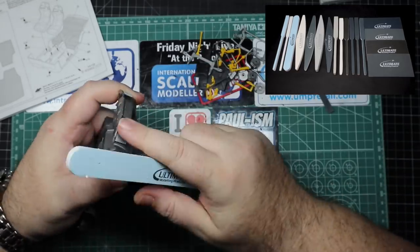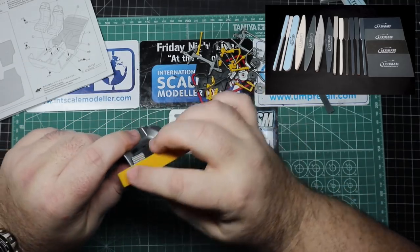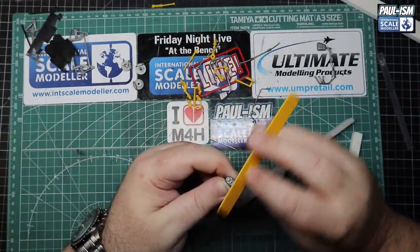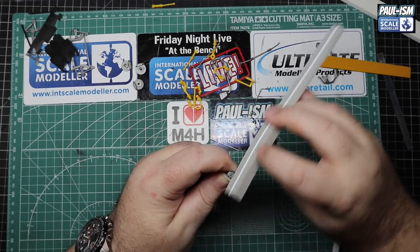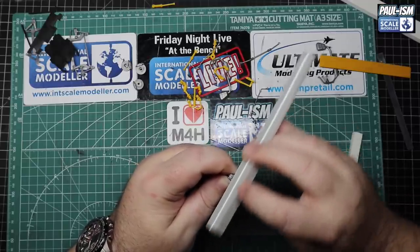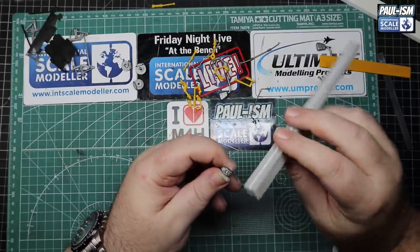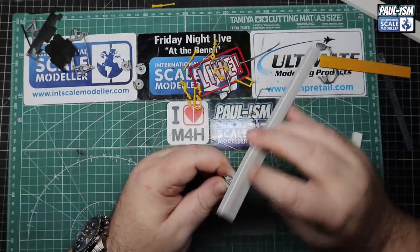Nice straight edge on the chassis. Easily cleaned up, so go around systematically, make sure everything's cleaned up. If you're not happy with it, hit it again, repeat the process, and keep going until you're happy everything's cleaned up. Now, pick your weapon wisely. So on the brake calipers on top, we use the customizable 400 first, then we use the thinny sponged 220 to keep the shape of the caliper so we don't flat everything off. And just work through our part.